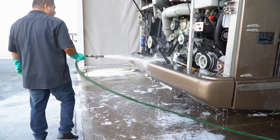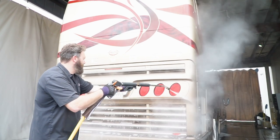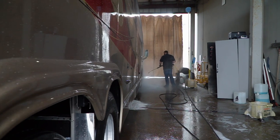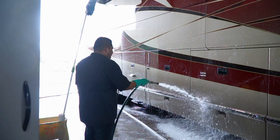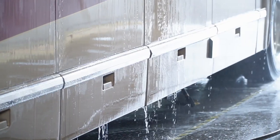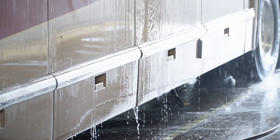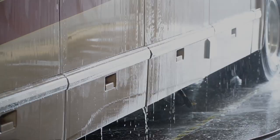If you're not using filtered water, you might want to have some microfiber towels on a pole so you can dry the coach off really well. You can use a squeegee to squeegee off the windows, but don't use that on the paint. If you're using filtered water, you can let it drip dry and it won't cause any water spotting. If you want to use tire dressings on your coach, you can refer to the hard copy that we have — you should be able to find it online. Hope this helps you guys keep your coaches clean and scratch free.